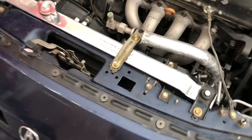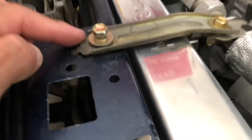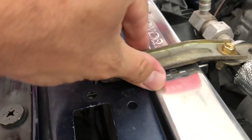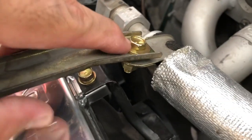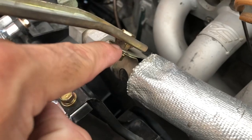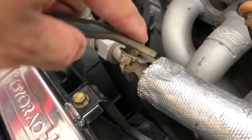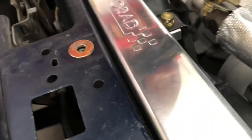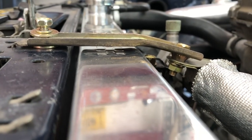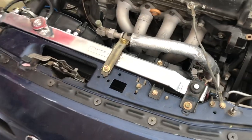For those of you still running AC, you're going to want to lift this bracket up just a little bit, and with a few OEM pieces you can do that. Get yourself a washer, a longer bolt, and a nut. Secure this clamp from the bottom of the bracket, thread the bolt through and then the nut, place the washer right there, and then just secure it and tighten it. That's going to give you that much clearance right there. If you're not running AC, then you don't have to worry about that.